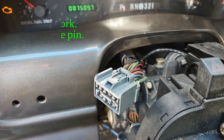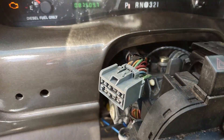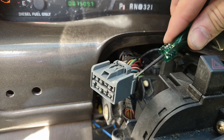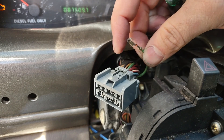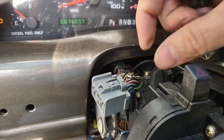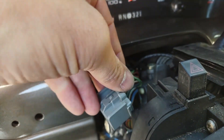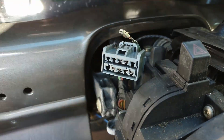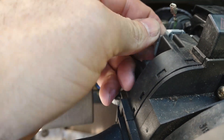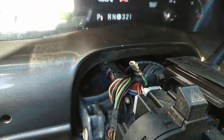It's not easy to undo the wire without cutting it, but you need to pop this out — that holds the pins in so the electrical connector doesn't just pull out. The pin that holds it in is on the bottom, so you'll need to use a tiny pick or sewing needle and push it in underneath the wire, which allows the wire to come out. Go underneath the wire to push that plastic clip down to pull it out. Then take a little bit of heat shrink and go over this to protect it so it doesn't ground out. Put the clip back in and the connector back on to keep the pins from coming out.